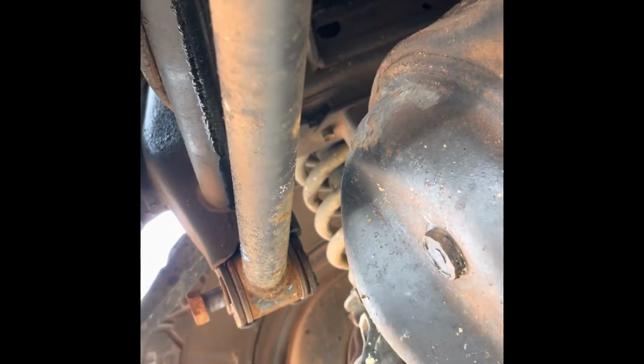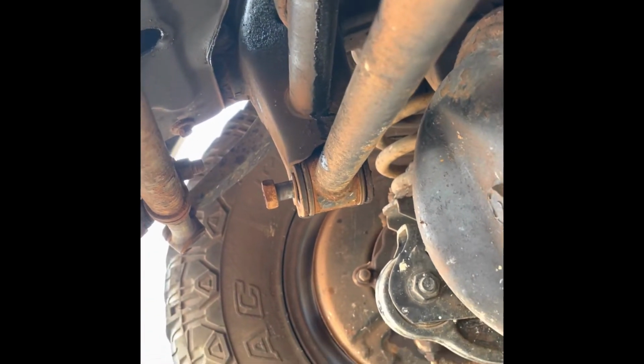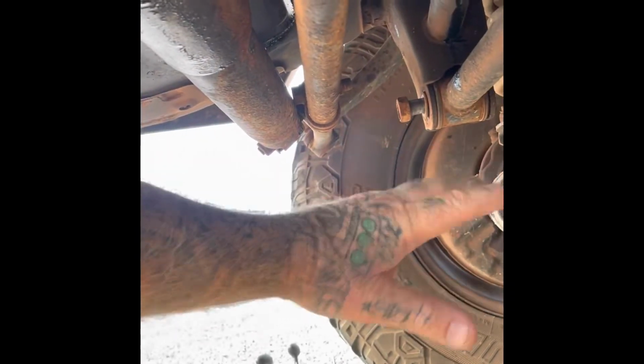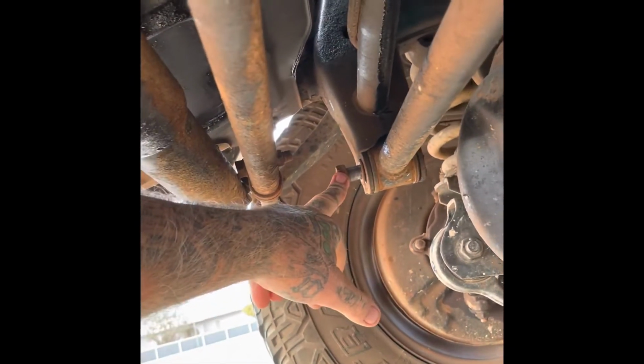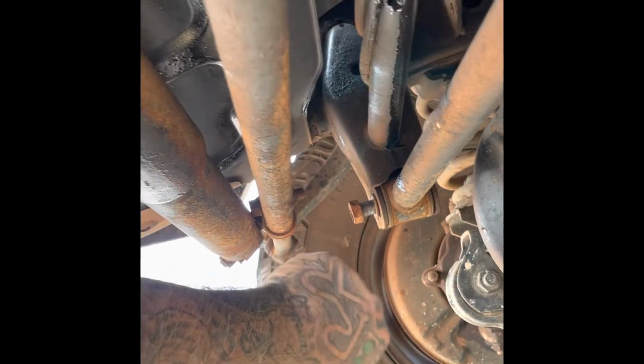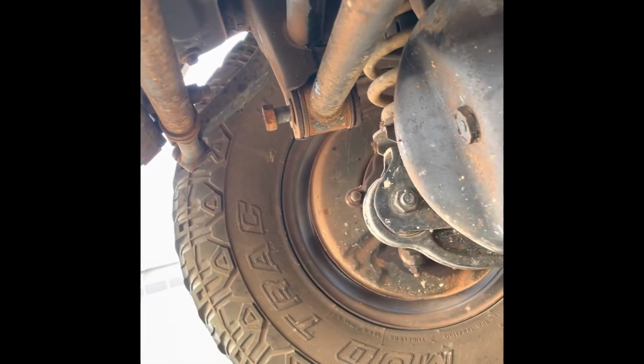So we'll bang that back in. I'll get a nut on the back of that and a washer, and make sure nothing like that happens on our trip. But being off-road a few times, shaking around, it obviously wasn't overly tight to start with. The nuts rattled off, and over time the bolt's coming out. But I'll have something on board to fix that.